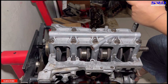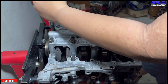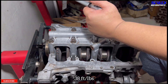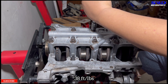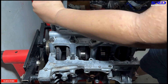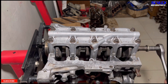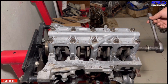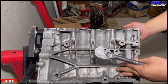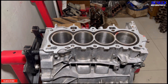Last three bolts on the first step, then the second step is 38 foot-pounds — it's going to click loud. We time-lapse the rest. The crank spins lightly and freely. It has assembly lube so it's supposed to be a little more sticky, which means there's more load — but it spins quite freely, which is a good sign. Some assembly lube dripped onto the bore so we wipe that off before moving on.